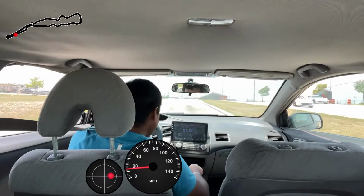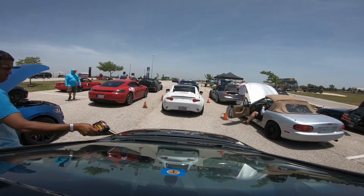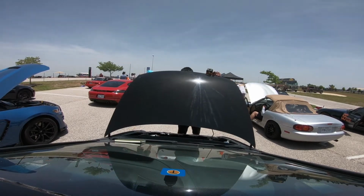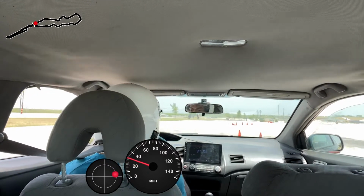After each run, I make a habit of collecting temperature data for the brakes, engine, and transmission, as well as tread depth data and temps on the tires. I ended up stiffening up the front, but my adjustment screw on the front left is frozen in place. I'm not sure why that happens, but it needs to be fixed on another day.